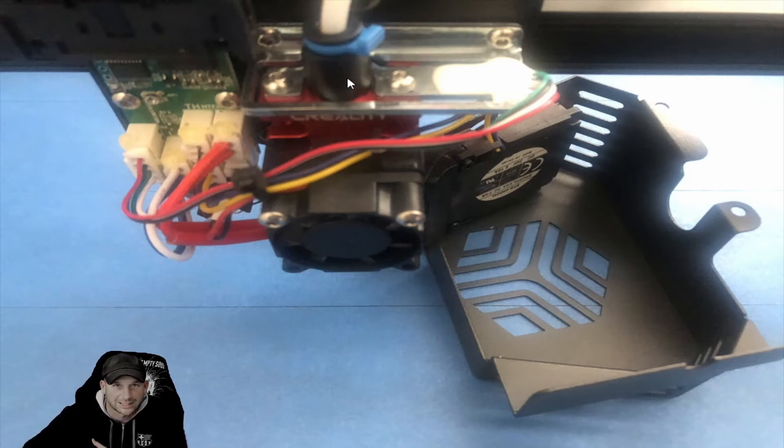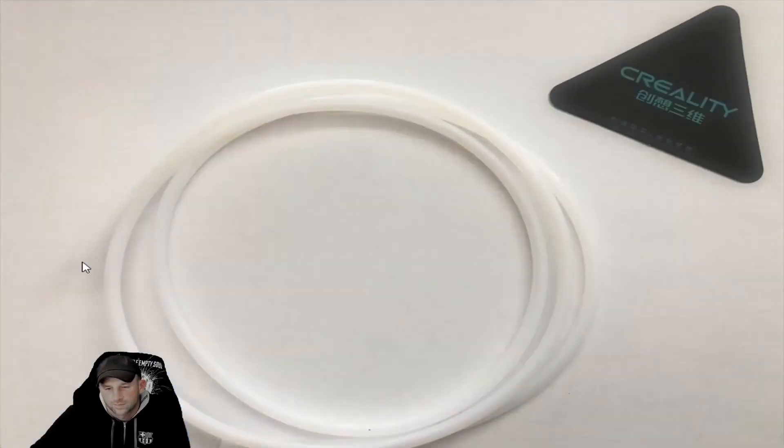Having it heated actually helps you when you're cleaning it out so nothing is drying up down in there. You take this component off — it's just a little snap ring — pull that out, then take a wrench and unscrew it. It's more or less like a cover where the tube goes into. Once you unscrew that, you can pull it up through and the tube will literally pull right out.